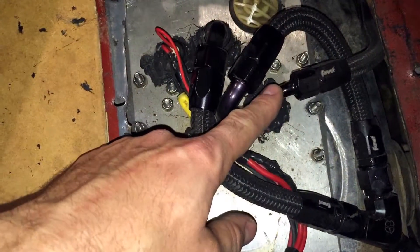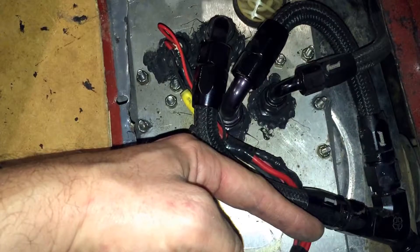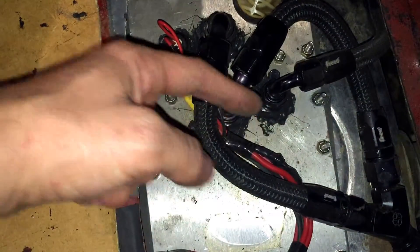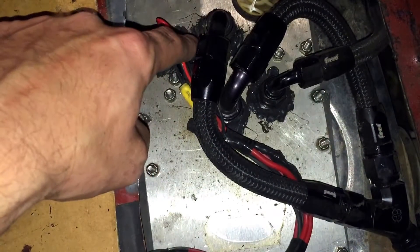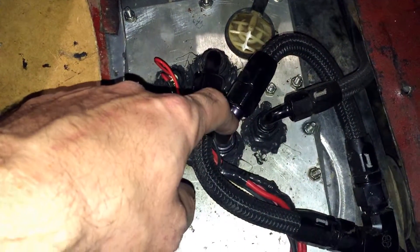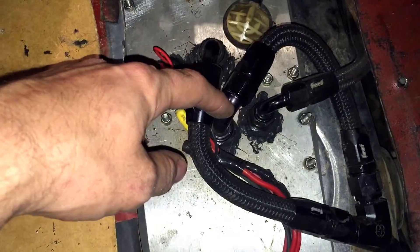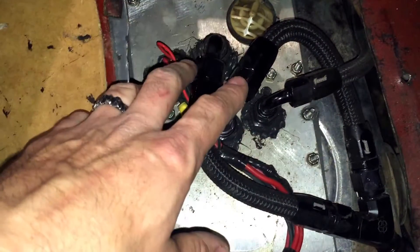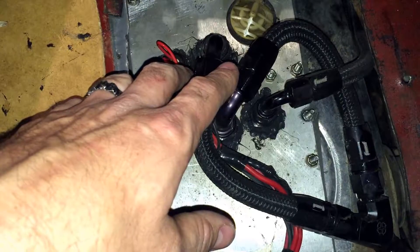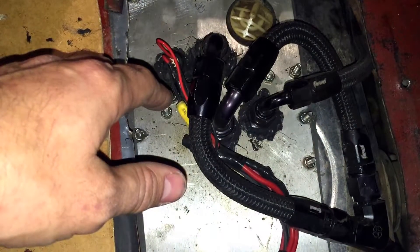What this return line does is go all the way to the bottom of the tank and actually exit back over in this corner, so all that turbulent flow is not right where the pump pickups are, because the pumps are straight down from here. There is also a way that you can fix your stock fuel hat if you just want to eliminate that aerating of the fuel — I'll have to show you guys that after I get out of the tank, since my tank's full of fuel right now.